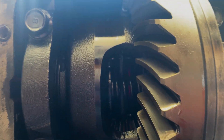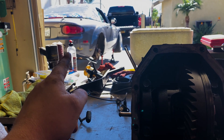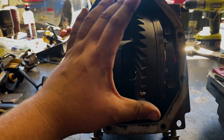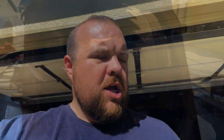This should look literally identical to an NC Super Tochigi LSD unit with the spring inside — use this as a comparison if you bought a differential online, since I've been burned before getting an open differential. This is a 4.44 ring and pinion on an 8-inch ring gear setup; the NC uses a 7-inch. Bigger means stronger in my mind, and while the car never made enough power to break a differential, I already broke a hub — so I figured why not go all the way. This is a brief overview of what I'm doing, so consider it a part one.